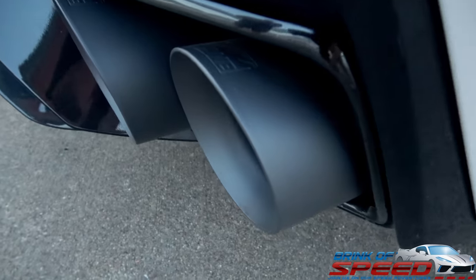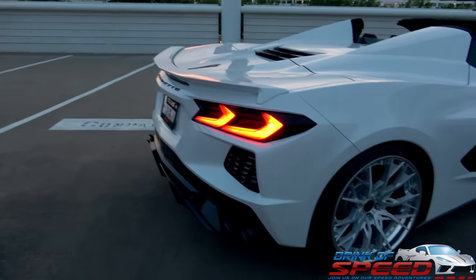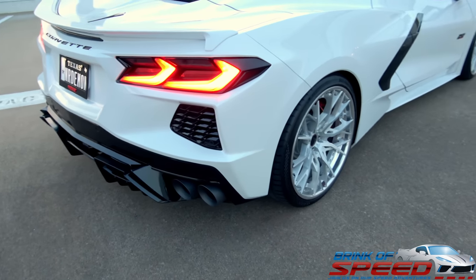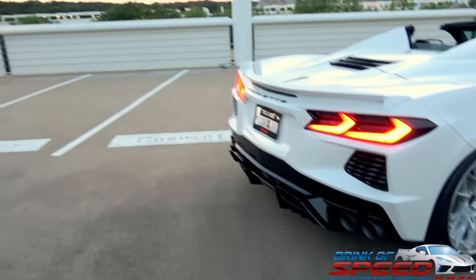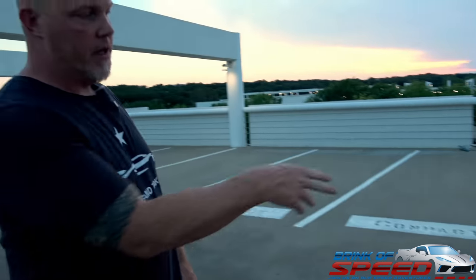I went into Unit 14 in Plano — Trevor's friend — and started talking to them. They had all the colors out there and I was like, maybe I should do something different. Then it clicked in my head: McLarens and Porsches will do almost that exact same color — a really dark silver-black — and they look amazing. What this finish is, for people that might wonder, is actually not powder coated — it's Cerakoted. The reason I did that is if you powder coat exhaust tips, because of the heat they'll keep curing and get blotchy. So we went down the direction of Cerakoting. They came up with the blend — said they'd redo it if I wasn't happy — and I was super happy. It's a 90% black, 10% silver Cerakote.